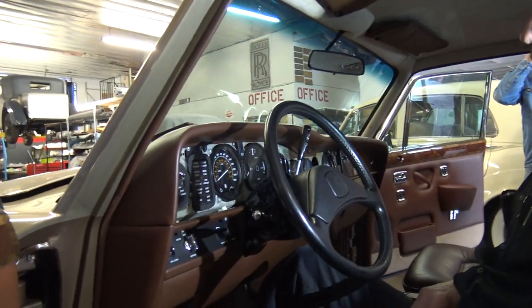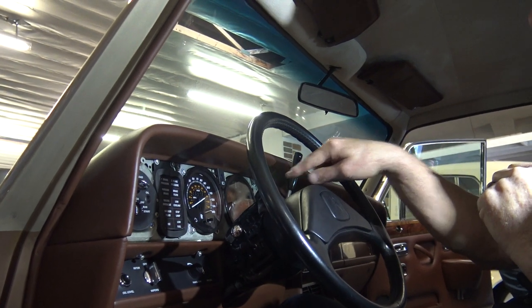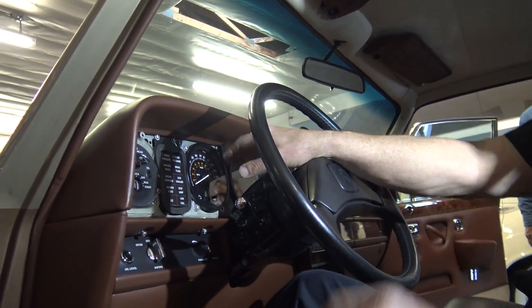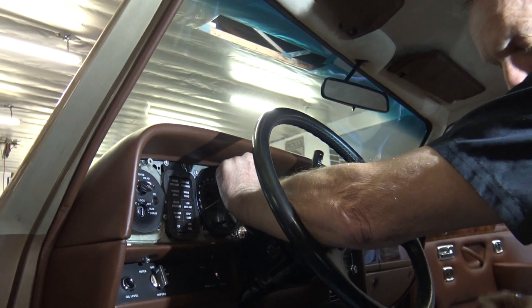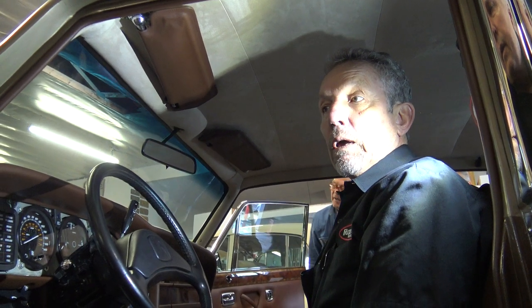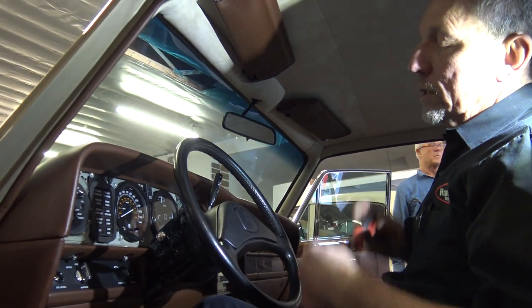So the speedometer itself is held in originally with four sheet metal screws. There's one more down here. Now, me being a little bit lazy — when I take something out and I see a screw that I'd have to take half the car apart to put back in, I think, well, that's kind of stupid. This speedometer is not going to go anywhere with three screws; there's no torque or tension. Do you need to disconnect the battery while working on this? Well, if you read any British repair manual, the first thing you do is disconnect the battery. This does not have any power to it until the key's on, so I think you're fairly safe if you don't turn the key on, that you won't short anything.